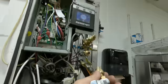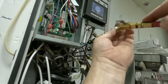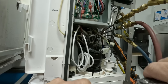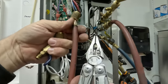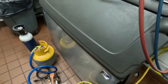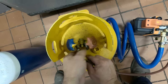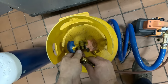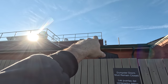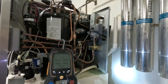What we're going to do here is use a T fitting — I've got the valve core pulled out of one, I'm going to pull it out of the other one, then we'll just jump it with the hose. That'll speed it up quite a bit. It's liquid, so I'm going to go through the suction side because it doesn't have a dip tube, so we can actually expel it a little quicker. You can see the ice machine is right here on the right-hand side.